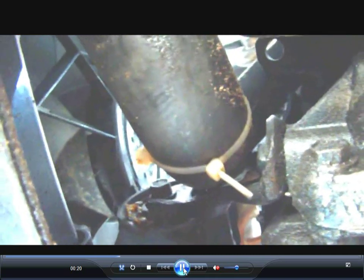But it's not super difficult to take out these motor mounts. It requires a lot of hammering to get the inserts out with a chisel, and I'll explain something on this a little bit further. But this trick I'm going to tell you is actually what I really want to get into on this. You obviously have to take out that center bolt, and the radiator support has to come down.